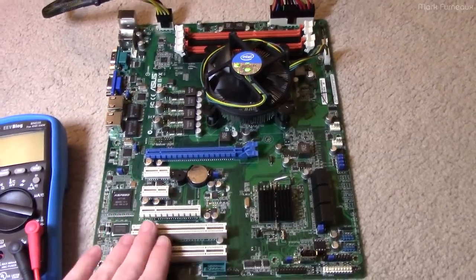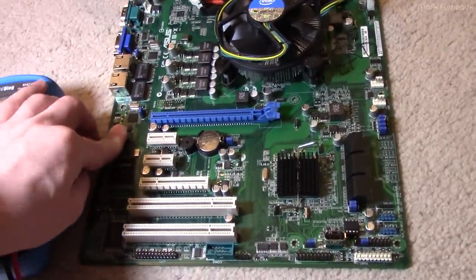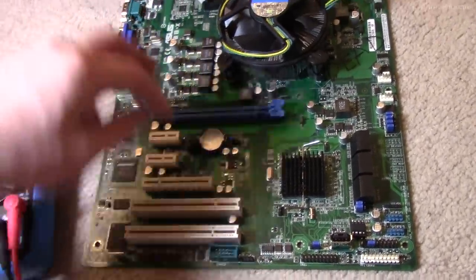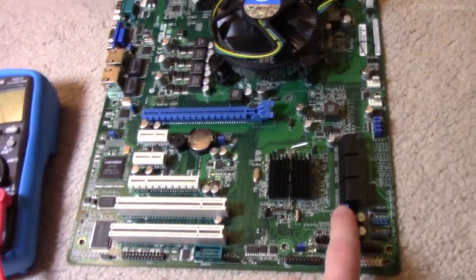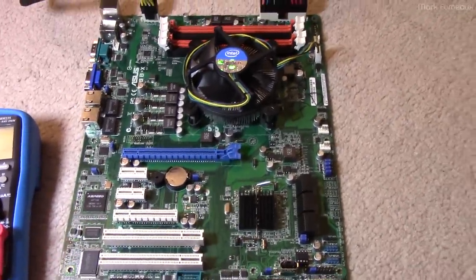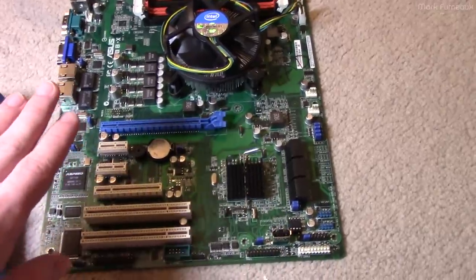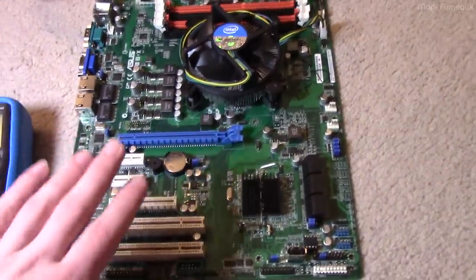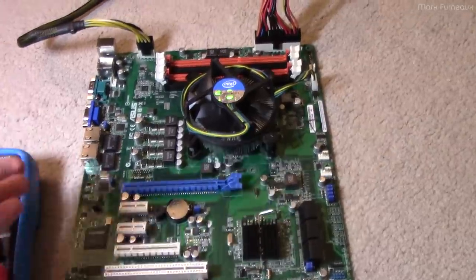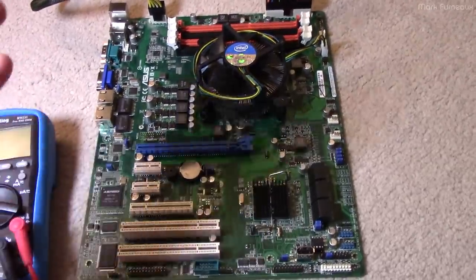The next logical thing to do is to disable things that are unnecessary. This board has the ability to disable the graphics and the two onboard LANs with jumpers. It can also turn off Intel Management Engine and other things. That's specific to this board — your board probably won't have that. And honestly, given a problem this early, these pieces of hardware aren't going to be initialized that early anyway, but it's worth a shot. I've already done that off camera, and it makes no difference, so I'm not going to bore you watching it do nothing.